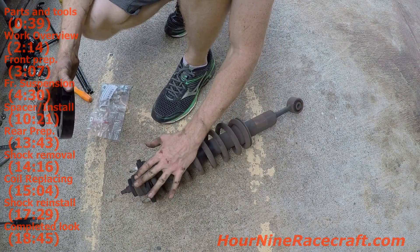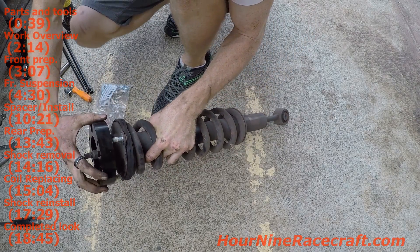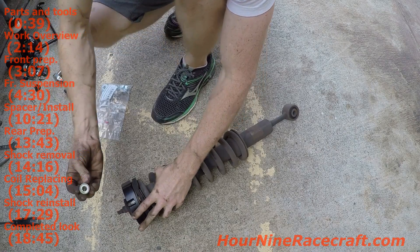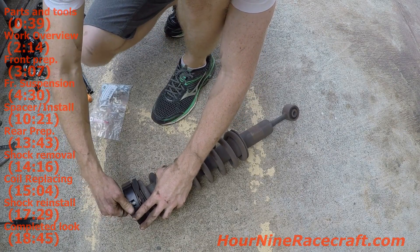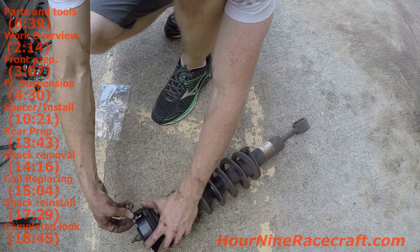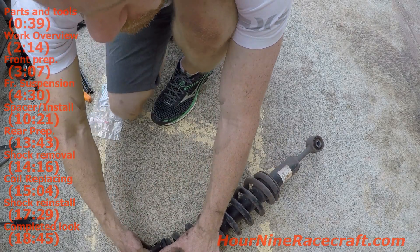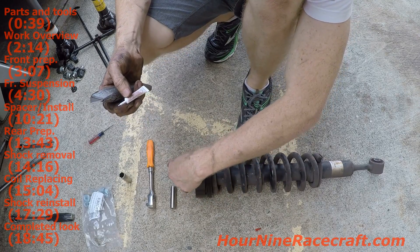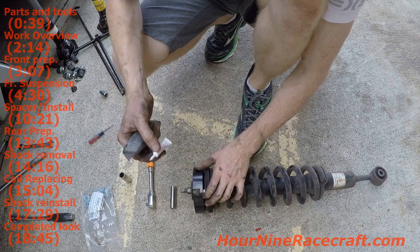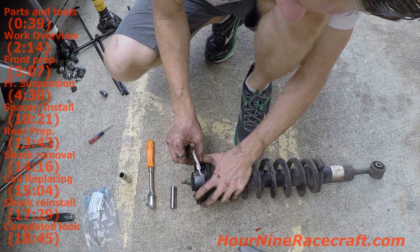So this is the spacer - again this is the Skyjacker two-inch kit, link's in the description. That goes there with the factory nut; you can screw it on the inside. You want to tighten these down before you put it back on because once you slide this into the strut tower, you won't be able to tighten this down. You'll need a 14mm deep socket to tighten this. Since the 14mm nuts hold the spacer, once it goes underneath the strut tower you can't re-tighten them - so this is the main place I'm using the thread sealer. This thread sealer locks the nut in place. Just put a little dab on there and the nut will spread it out.